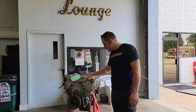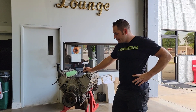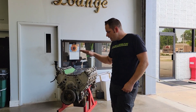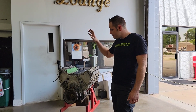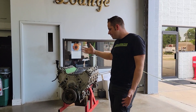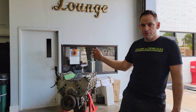Alright guys, so here's the new engine we're going to use — it's a 6.2 liter L92, roughly the same thing as an LS3 by the time we tear it down and do a few things. Our plan is to pull the heads off, do head studs, do a spring upgrade in the head, and then go ahead and put our pulley system, valve covers, and oil pan setup on it. Then we're going to do a little bit of a cam upgrade so it will handle the boost a little bit better. Other than that, we'll tear it down, make sure it looks good, refresh it a little bit, and get it ready to put back in the car.